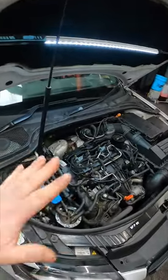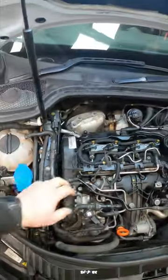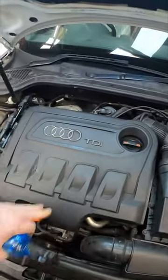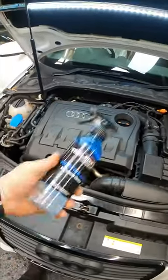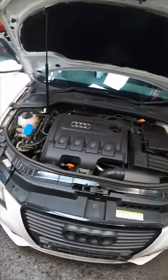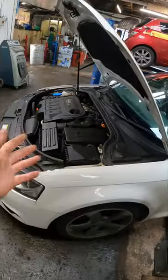Once we've done all that, we can get on the key - and there we go, that car is now running like brand new. Now it's up and running, we're going to leave it for a couple of minutes and check for leaks around all the fuel lines. We're happy there are no leaks whatsoever, so we get all the trims back on and give it a clean with a bit of Pristine APC. There we have it - looking like brand new. All I've got to do now is take it down the road for a 10-20 minute test drive.